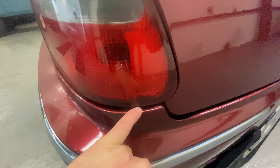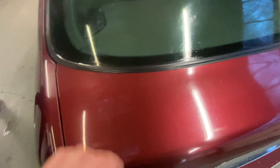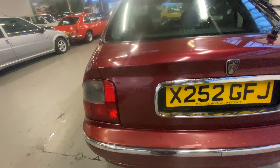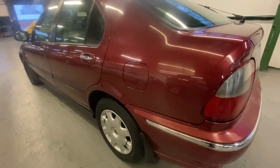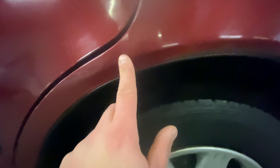The light lenses are all nice and clear. You can see the bumper is sitting out of line on the corner. The boot lid itself is all right apart from some scratching in the paint — a little bit flat on the boot lid there. The rest of the deck lid, the back section, is all nice and straight. The chrome around the number plate and the chrome on the bumper strip are all good, no major scratching around the petrol cap. Coming onto the left-hand rear arch — tiny little bit at the bottom but nice and straightforward, these old Rovers, no signs of major corrosion.